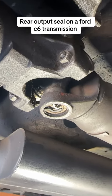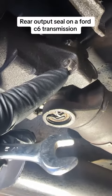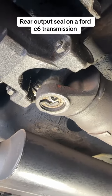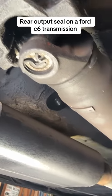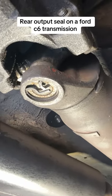We'll be taking off the drive shaft, but to do that I gotta take off this u-joint — half inch bolts and nuts right there. I put the car in neutral with power jacks on each side spaced out so I could get the bottom two nuts off, push the car up a little bit, get the other two, and then it drops right down.